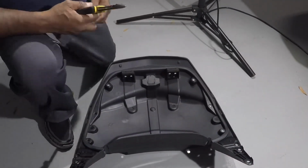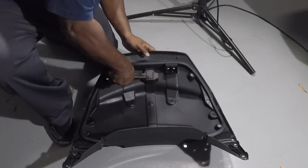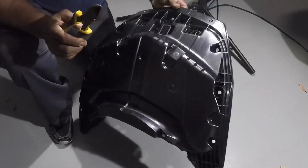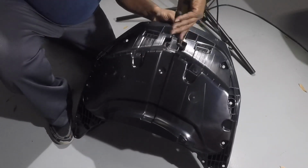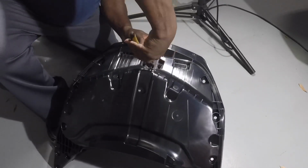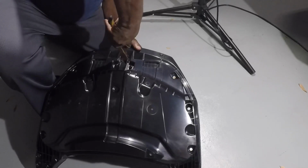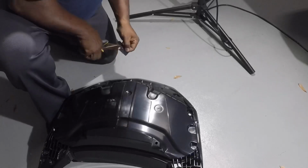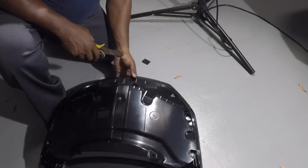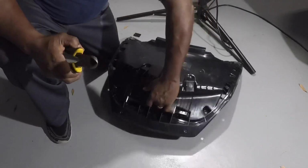Before you move further in putting the harness on, I suggest you go ahead and cut this preform spot out of the way for you. You should use a pair of snips. It's a little difficult. Turn it over. It's easy to get to from this side. There we go. Just cutting it out, straight against the edge. Then make sure you get all the edges off. That's where the light's going to install. See it?